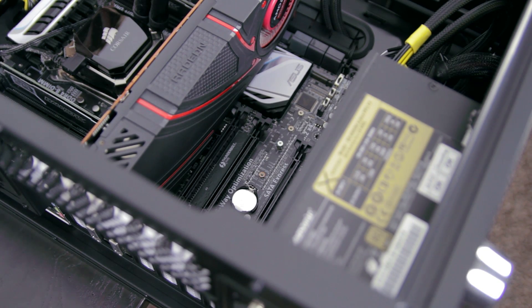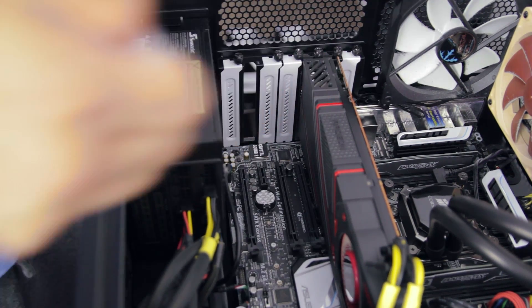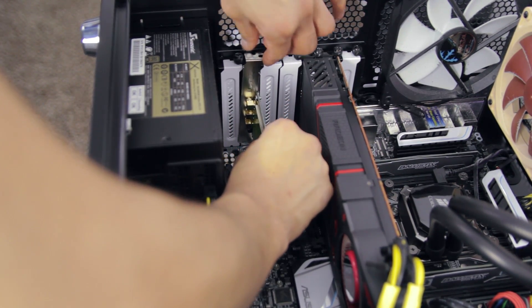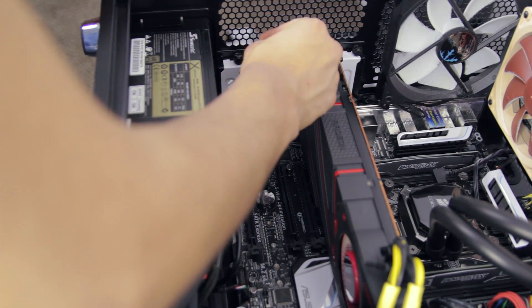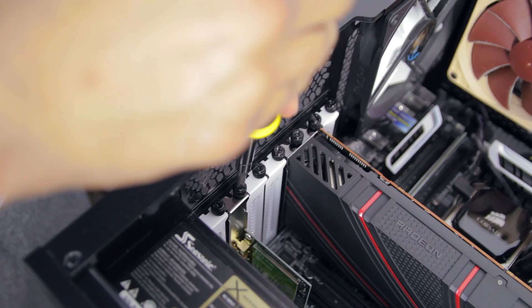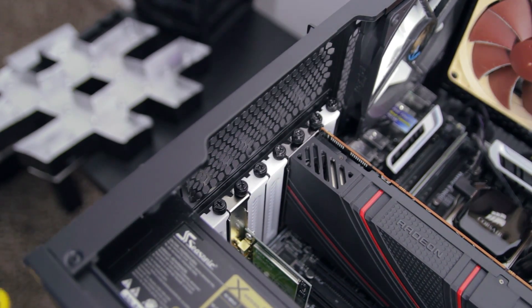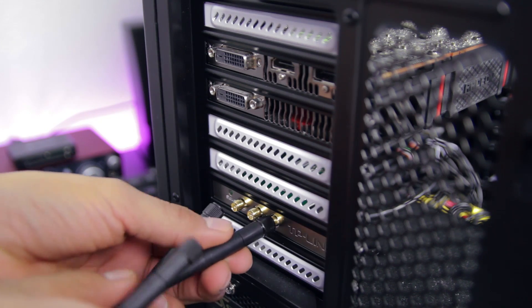It should just be the smallest slot on your PC — you can tell by the way the WiFi card slot looks. Now take out that bracket and line it up with your wireless card on that PCI Express slot and just press it down. That's pretty much it, it's really easy. But make sure it's all the way in, and then start putting back the screws to hold it in place. Put back the side panel on your PC and start putting on those antennas that came with the card.